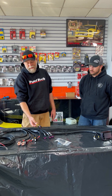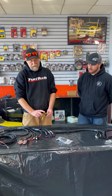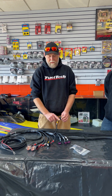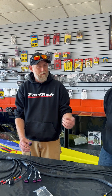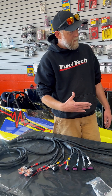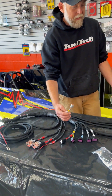Last here we have yellows — these are also outputs and they're kind of unique because they can be either ground or power triggers. You just have to be careful with them because they have a bridge in them, meaning if you're going to ground-trigger something, when it's not being used it'll rest on 12 volts. If you're sending 12 volts it'll rest with ground, and if you're sending a ground it's going to rest with 12 volts.